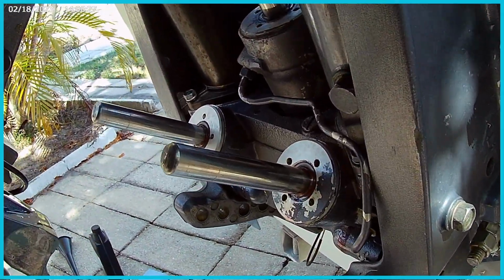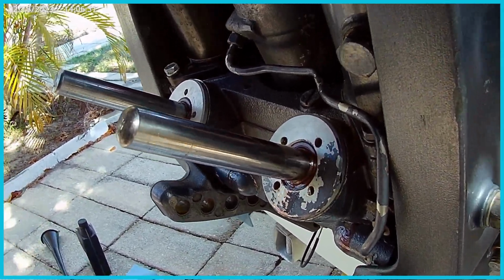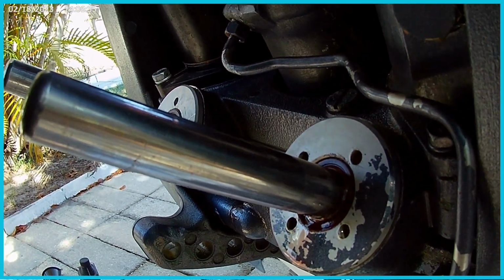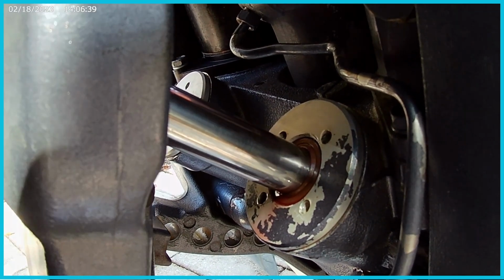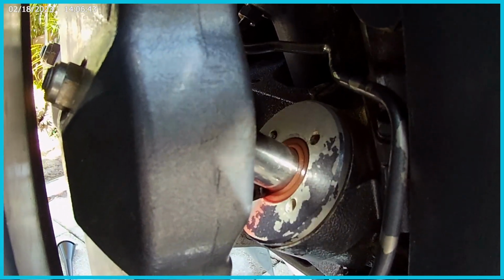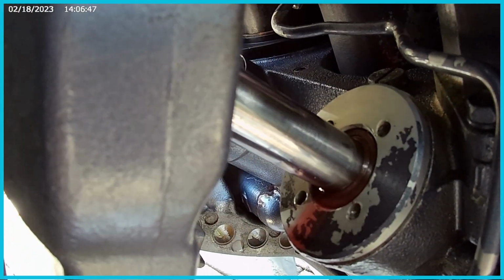You can already see right now what's happening there on the ends of those rams and the pistons. See the oil dripping out of the cylinder. So I'm going to lower it here, and then you can see what I'm talking about. And those are new seals actually in the end of those caps right there. So that's far enough, you'll be able to see it. See it just pour right out of there.